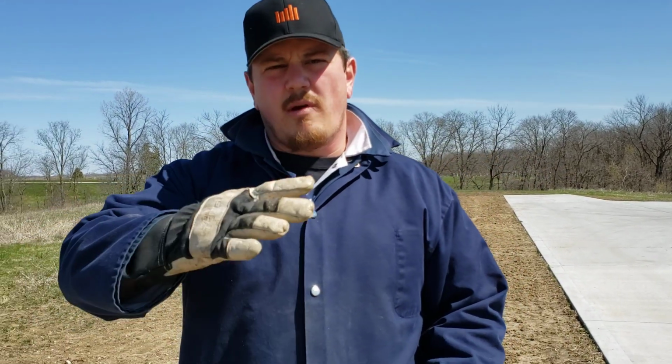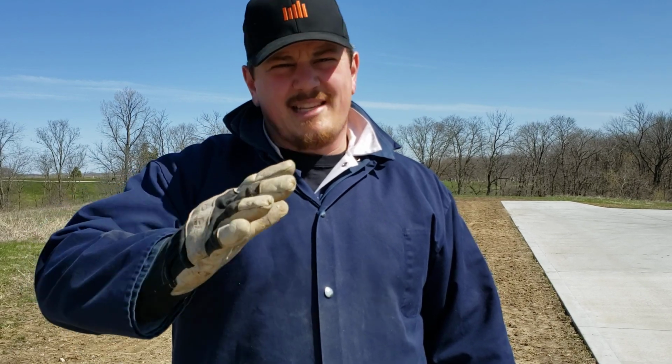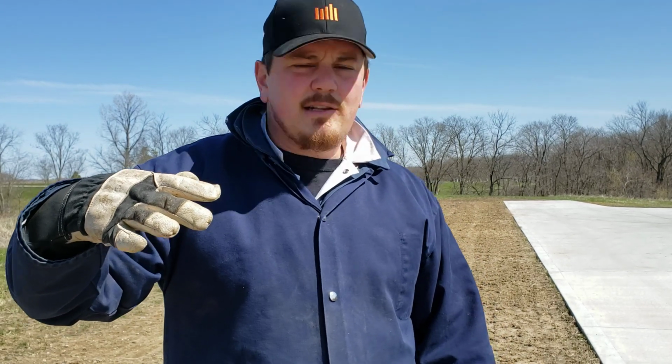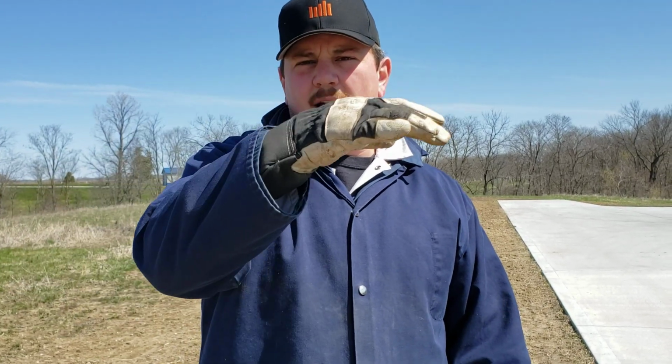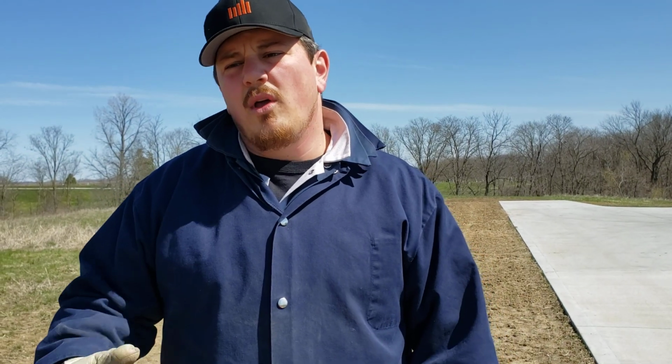If this was a garden, it'd be so much easier because you're not contouring the ground. And obviously with the 3-point, hydraulic pressure isn't down, it's just lifting. So when you let it down, it just floats. And as a result, when you go up onto a bump or whatever, i.e. the driveway, it's a little bit challenging because you have to be right on the control, and then it takes time for things to respond because it's pulling through this dirt, and that reverse action really helps to pull it in. But as a result of pulling it in like that, you do end up with a slower response time, unless of course you overwhelm it with a bigger tractor.